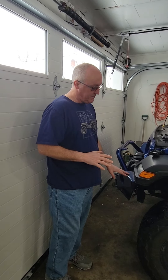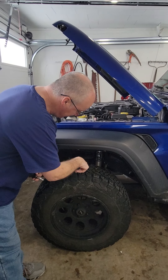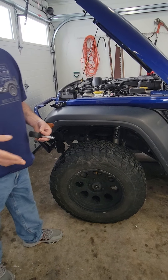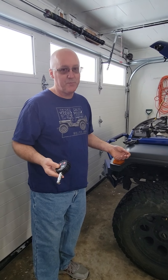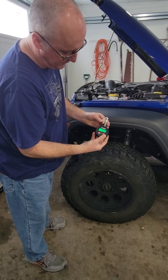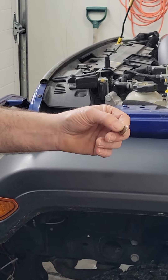The next thing you want to do is take a look at tire pressure and tread depth. I'm only going to do one tire here — you're smart enough to do the rest. So let's check this. Right there, we're at 34.6 pounds of pressure. On this tire, it's good.